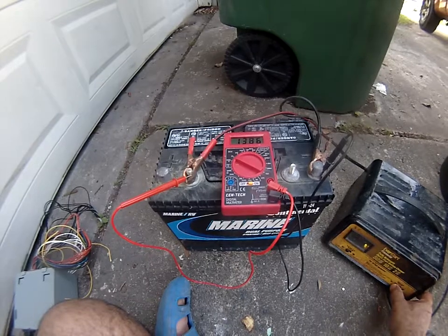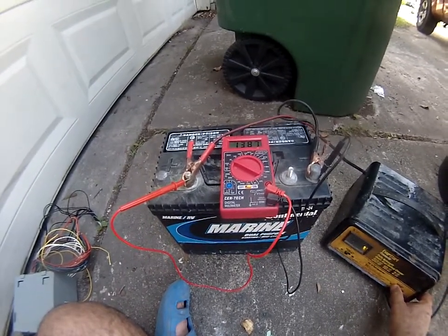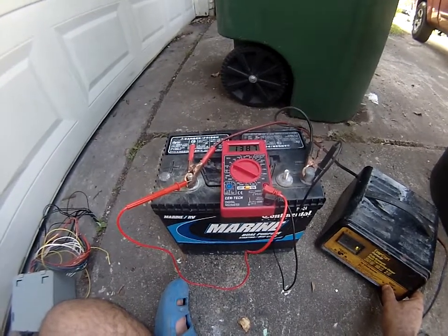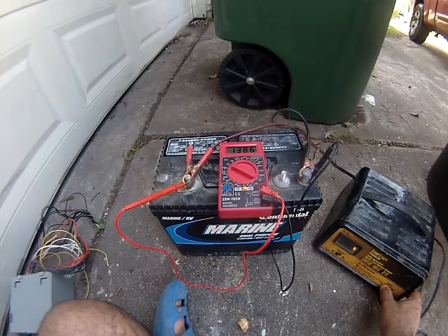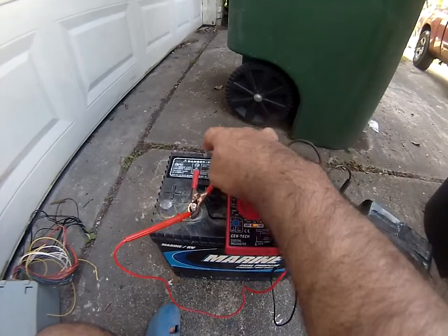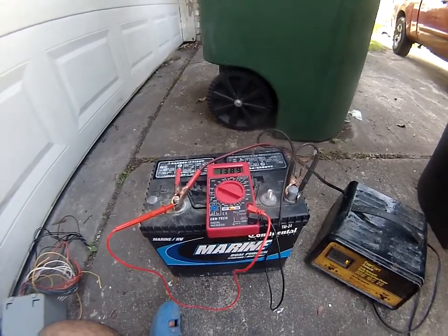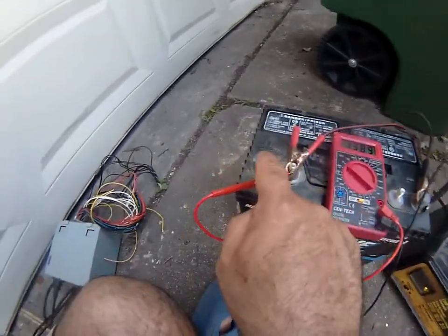I hope this helps somebody. Manufacturers want you to do it at 10 amp — most manufacturers like it at 10 amp. They don't want trickle charging at 2 amp. For a big battery like this, 10 amp is preferred. You can get away with 50 amp or 20 amp, but long run you want it at 10 amp. It's also a good idea to pop these covers and check the water, using distilled water, and clean the terminals.